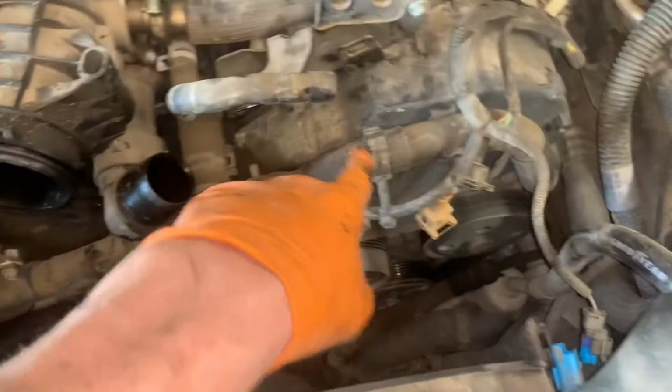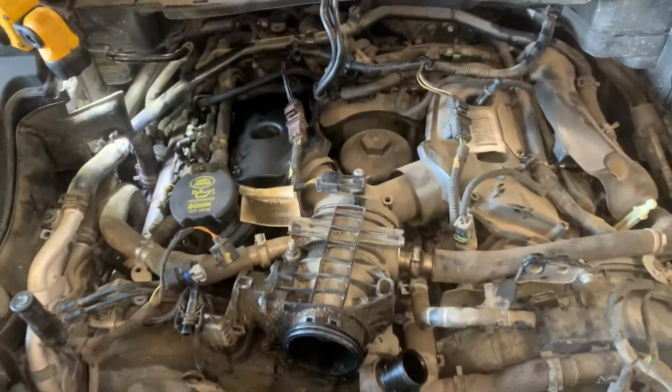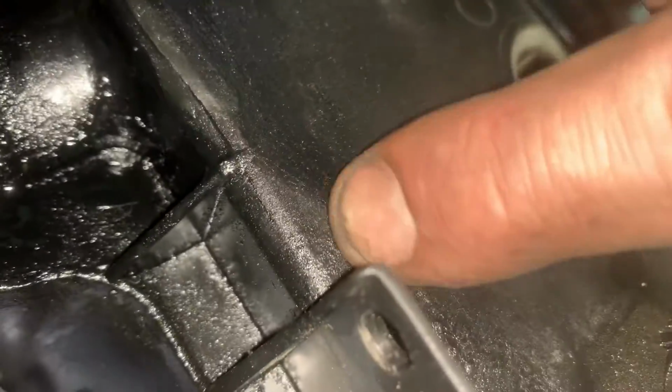We're going to get these EGR pipes off and strip off the pipe work on the front, and start getting the tubes off over the top. So we get a bit more off, and we'll come back and look where we are. Okay, so now we can see the amount of stuff we've got to strip to get these off. Now, you look, you see a crack along here, which is where they fail, which causes the boost leak.